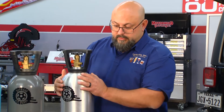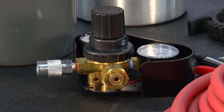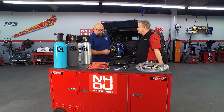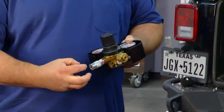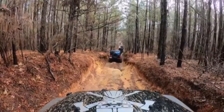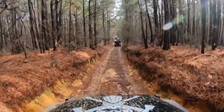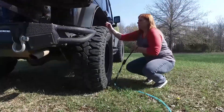There's a 10-pound tank that holds 10 pounds of liquid CO2, and a made-in-the-USA high-flow, high-volume, frost-resistant regulator. So when you're pumping 90 PSI through for a couple of minutes, you'll get a little frost around the quick-connect fitting but it won't restrict the flow — with some regulators by the fourth tire it's iced over and you're not getting much airflow. In terms of capacity, if you have 35-inch tires and take them down to 12 PSI, you can air up all four tires six times. If you only take them down to 16 PSI, you can air them up to 33 PSI ten times, all four tires — that's 80 cubic feet worth of gas.